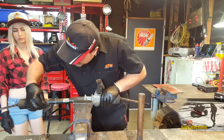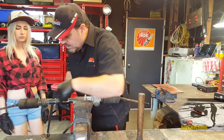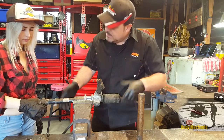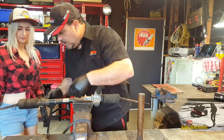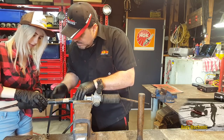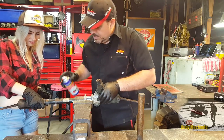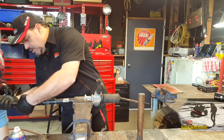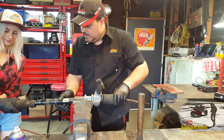Okay, so easiest way with these metal clips is you can just give them a wiggle. So if you continue to wiggle that, it should snap. Look at that, you see? So easy. Brilliant. That's rubbish. I don't need that one. Okay, so that's that off there, and we should be able to pull that boot off now. So you give it a quick turn. Yeah, there you are. A bit of dust going with it. A bit of crap. Put a bit of spray on it, might be easier. Oh, you got it. Cool. Got there before I did. Right. And then we should be able to pull that off there like that. There you go. So you can pull the whole boot off now.